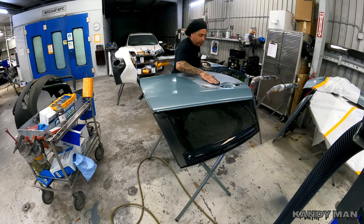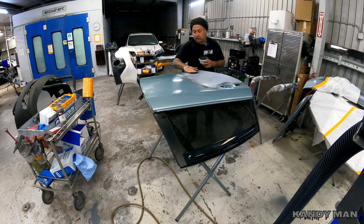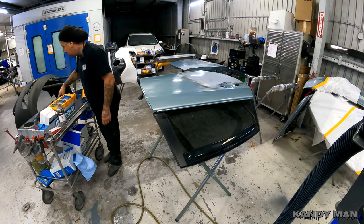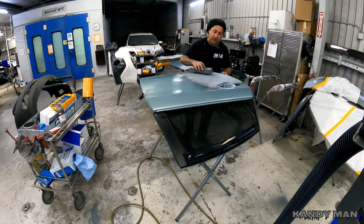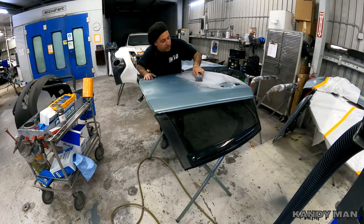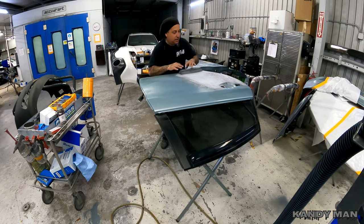This one you don't really need the guide coat — I always tell you guys how this P30 is shiny. I'm just showing you in case you guys aren't using a shiny primer. Hit it with the guide coat, and then I'm coming in with my 320 block using my regular DuraBlock. Use a vacuum if you have one. Once I see bondo or putty breaking through, that's when I stop — you don't want to keep sanding and get rings.